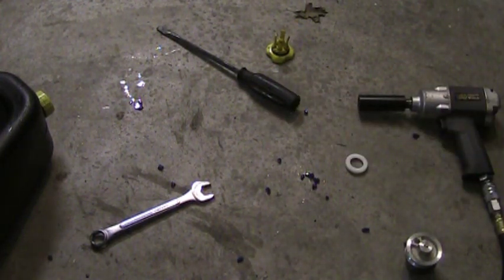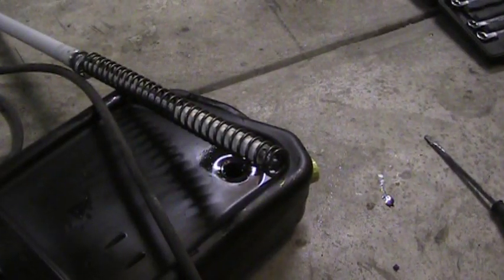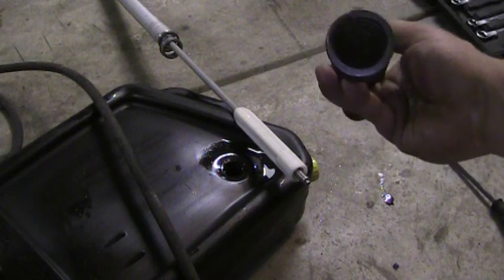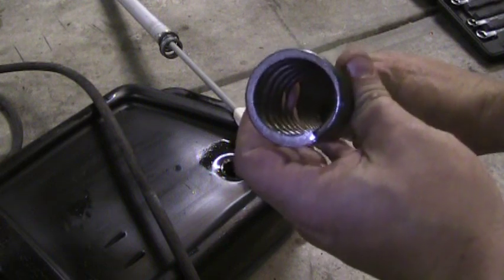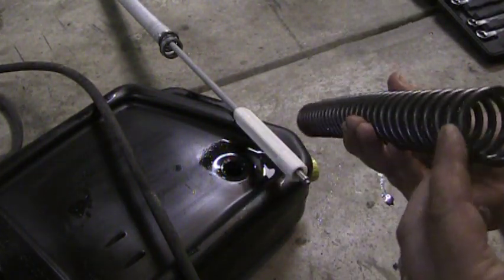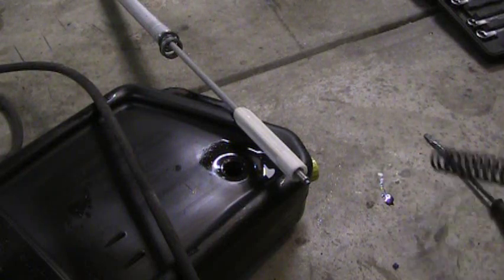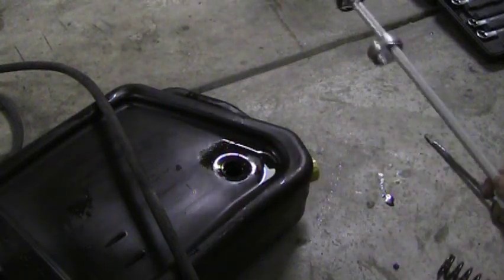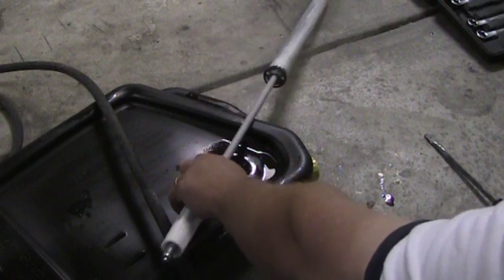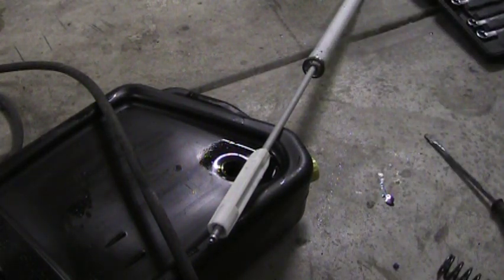Anyway, that's one reason why I did the first one off camera. So next thing you want to do, slide your spring off — it'll just simply slide off. You can tell the markings on your spring: stock spring will have no markings on either end. If you have a soft or hard spring, you'll have notches — like two notches for soft — or some kind of little slots. If it's aftermarket, it'll probably have the rate on it. These are stock, they're .43, which for my weight are fine. But you do need to measure the length of them, and usually that's what you would use these preload shims for. There's four of them — way too big, way too many. We will be using one of those.